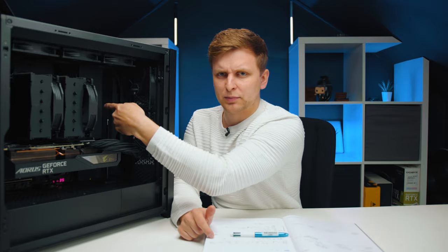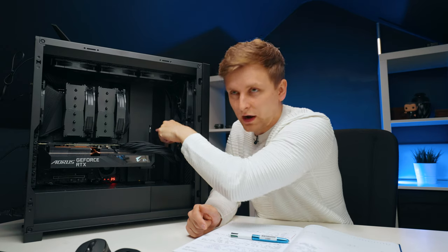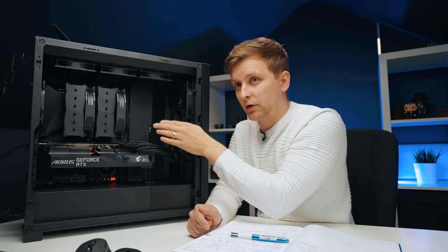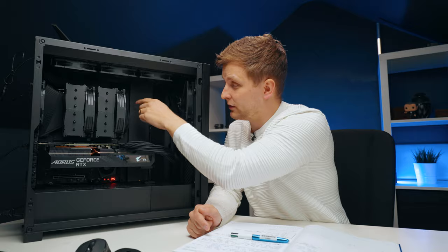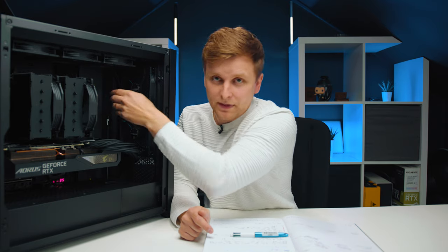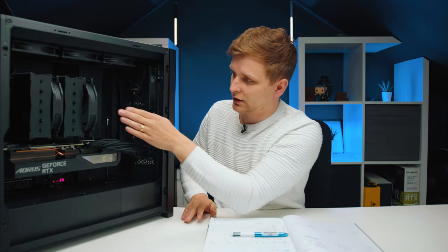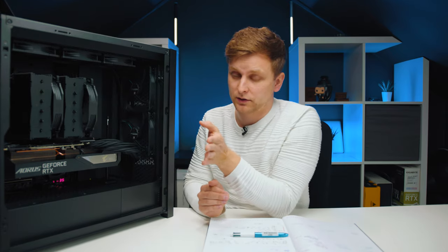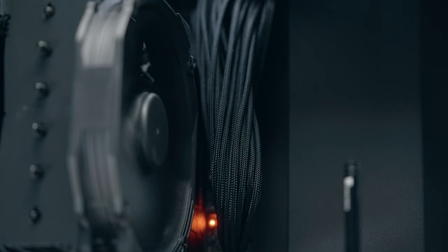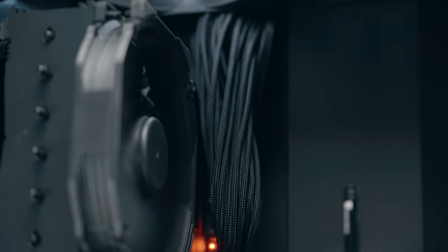You might wonder if the air is being blown into a blockage, but that's not the case. The shroud is designed to push the air, curving it around towards and underneath the motherboard. If you put your finger behind that gap you can feel the air coming through, pushing through and cooling the RAM and the back side of the motherboard — because the back plate of the CPU cooler can get very hot as well. So now that area gets cooled too, which I'm super happy with.